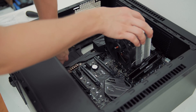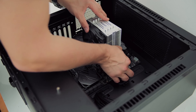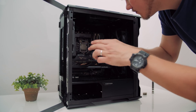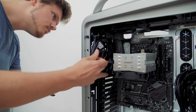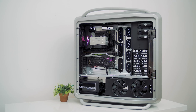Double check all your mounting points. Even a slight screw misalignment might cause your system to short out. Use the I/O shield and double check that the motherboard standoff — the extended one that usually catches the motherboard — is aligned properly in the hole to avoid any shorting due to improper mounting. If you're using an all-in-one cooler, double check how you want the radiator mounted inside the case and rotate the radiator accordingly so the CPU block remains horizontal. Otherwise the block might be skewed and the logo won't align properly. Remember that hot air rises, so set your fans accordingly — perhaps rotating the CPU heatsink to exhaust air upwards — but it's totally okay to also have horizontal air direction.